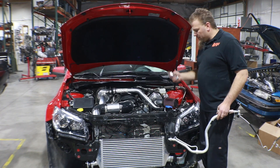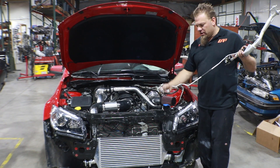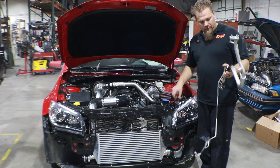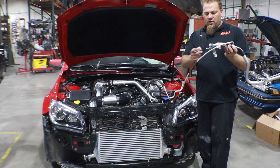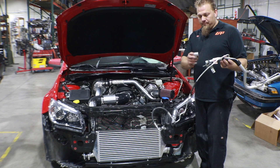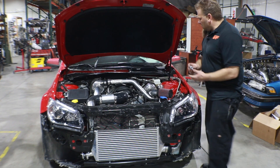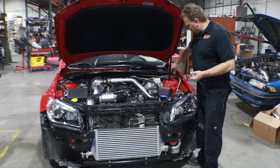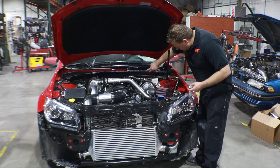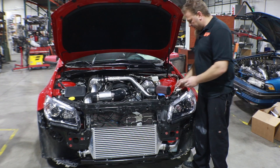That gives us a lot more flexibility in moving them around. We've done the same for the other end down here with the dash-4 which is actually going to go on the condenser — so this one's going to be made up in place for that one. And then for the other one where it bolts up here we've got this one that is actually going to bolt up and be able to plug our lines back in. So all these fittings here are going to allow us to replace that hard line with this nice flexible line, and we're going to come right off of the firewall here, loop up over this and come down here.